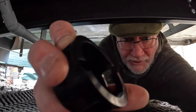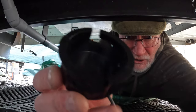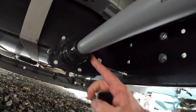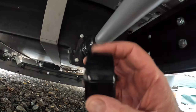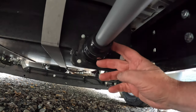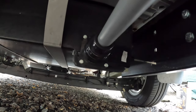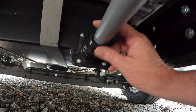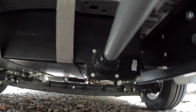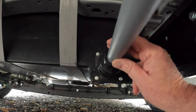Here's the gray waste stopper which comes with your Adamo and fits over your gray waste pipe. The kit from Prima fits on where the stopper used to fit. It comes with a fitment on the top and a washer — you want to make sure the washer is in there. This is a push fit and it comes out onto the pipe section.